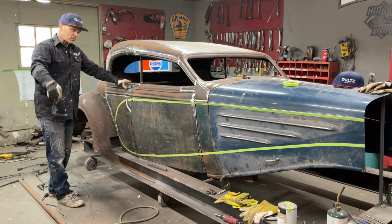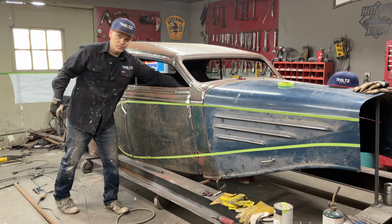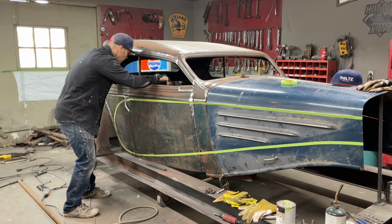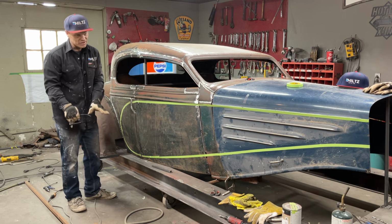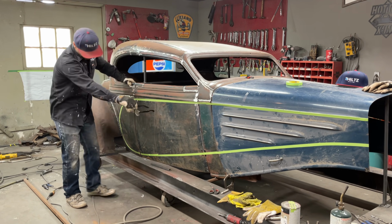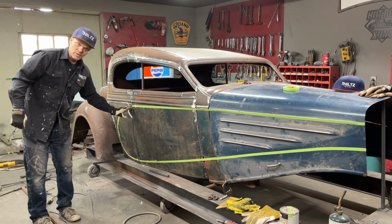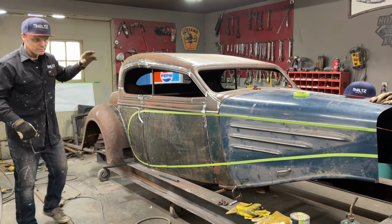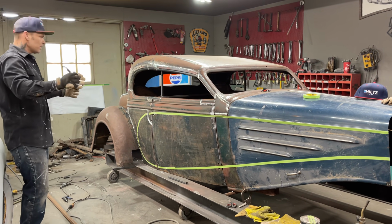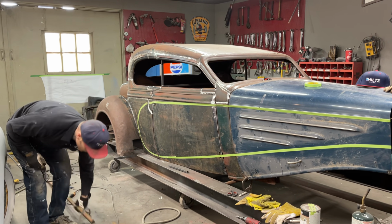And the exact same thing will go on the inside to start doing the floor work. So I'll put a square tubing on a piece on the inside. I'll find a spot down low. That'll be called my sill. So I'll put a square tubing all along the bottom, bend it just like I'm going to do here. And then that's where I can run my floor and start connecting my A pillar and my B pillar to make it a car. Because it's really not a car right now. It's just skinned up. We're skinning it, and then we're going to apply all the innards.